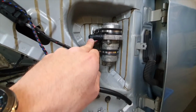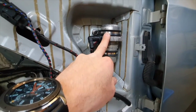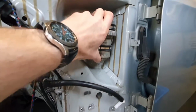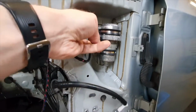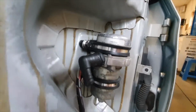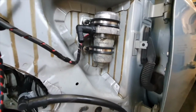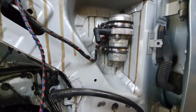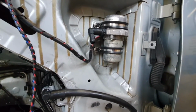So yeah, just a couple of P-clips, big ones there, just to hold it top and bottom. I mean, that's pretty fucking solid on there. And then again, me and my nylon spacers, I think it's about 5mm nylon spacers on there, and that's it. And then just a bit of thread lock in there, just so it doesn't come loose. Should be straightforward enough, I think.